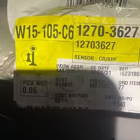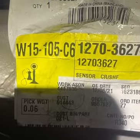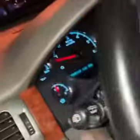All right, we can bring my little contraption down. Go ahead and put all the trap doors and stuff back on this thing. Let her run, do a steering angle reset, and yeah, clear the codes and give it back to the customer. All right. Just like that. Got all the codes off. When you turn the wheel left and right, no more of that craziness. As you see, everything put back neatly.